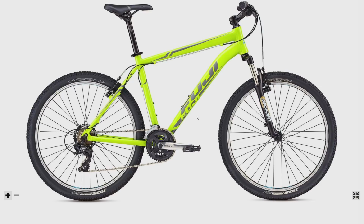Okay? The next thing not to look at is the number of gears in the rear. Usually at this price level, we're going to have 3 gears in the front and 7 to 9 gears in the rear. 7 is okay. 3x7 will let you go pretty much anywhere. Here you can also see this lowest mega range sprocket, which is made for climbing, and with the smallest ring in the front you will really easily go up the hill, even if you are not in really good shape just yet, but you will be, right?